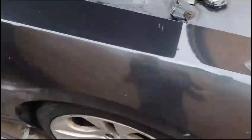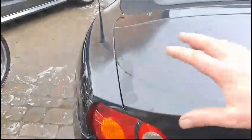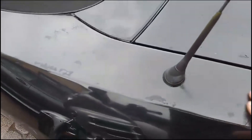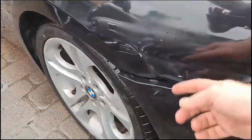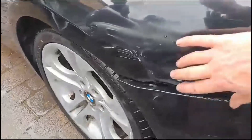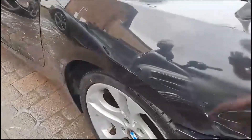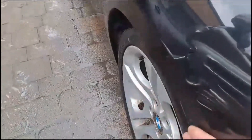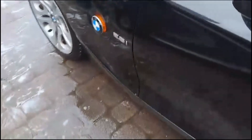This is definitely getting Raptored - we've got lots of scratch marks on here. This panel's not too bad, but you can see there's no shine in that one - it's been sprayed very poorly. The top of this has been sprayed very poorly as well. The side isn't too bad, but then we've got that repair to do. I put my magnet on it - it's steel, not aluminium, which is better because I'll be able to work this more easily, use less filler, and hopefully get a nice clean line back ready to reinstate the bumper and take the dent out.